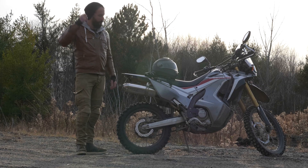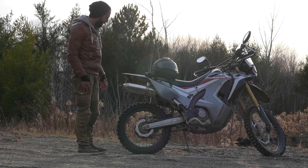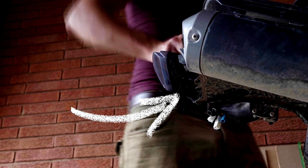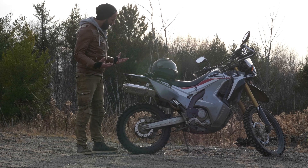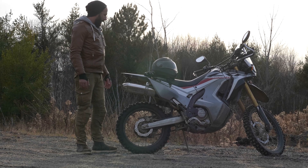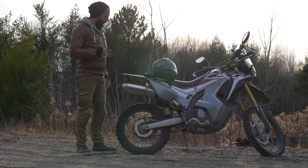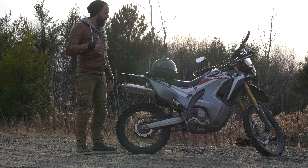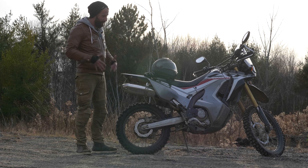I do have a few minor criticisms. The TST tail light looks awesome — I love the way it looks and it definitely reduces a fair bit of weight pretty easily — but there is an issue at the bottom. There's quite a bit of exposure there. I had to open it back up again after installing it and there was a lot of dirt and crud in there. I'll definitely have to look into coming up with some sort of customized piece to keep stuff from getting crammed up in there. The pipe I really love. I've noticed — it may have been due to my own error — that if the bike is cold when you first start riding it, there's a bit of a flat spot in first gear that seems to go away as the engine warms up. Once the bike's warm, it runs great and feels really powerful.